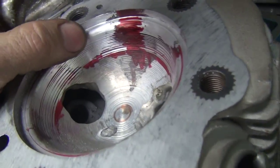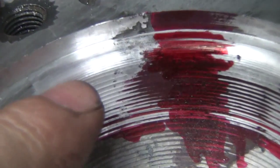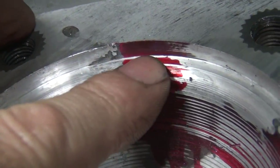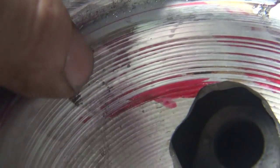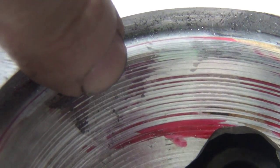I just finished up the combustion chamber cut here. You can see how it's a nice radius finish all the way up. This is new, that's old, this is new. That's right where the wobble is right there — see how close it is. This is all old over here. So you can see where I was cutting coming up here. The old stuff is the dark which I didn't even recut. It's real rough down here because that's my original coarse finish. I did a lot finer coming up. So that's how it looks now.